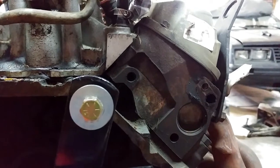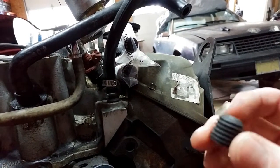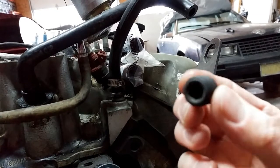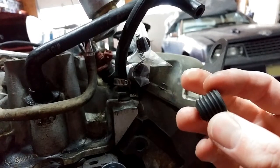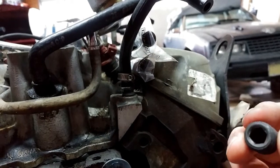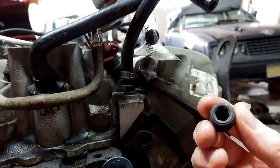If you can't use a tap because the engine isn't out of the car, I've got a trick for you. Here's what I found at my local hardware store. You can see it's a nice plug — it actually has an Allen head, takes a 5/16 Allen — and this is going to thread right in there pretty easy. This is $1.35 for me locally. Late Model Restoration actually has longer plugs that better mimic the originals, but those are $9 a pair. I'm going to do this for a little less money, a little more readily available, and put this one in with some red Loctite, because I don't plan to use that recess again.